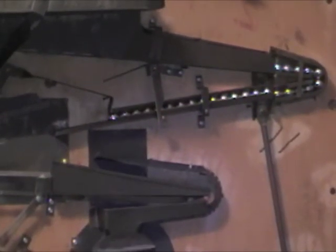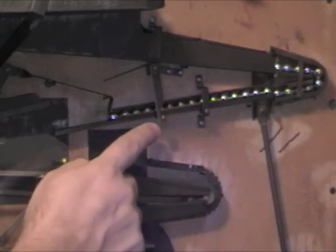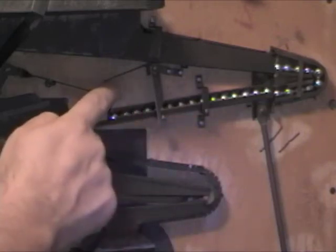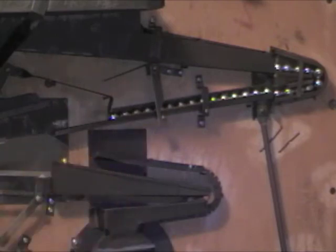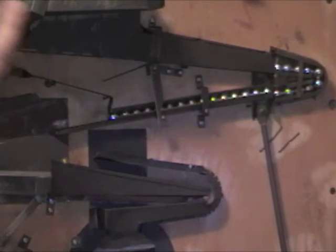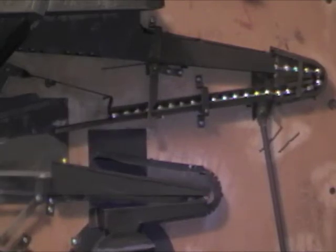Now going up, we see that that pole is attached to this track, and now this pin, there's not enough balls up here, so this lever has dropped down and locked. So the way to solve this is to add more balls to the top, or you could manually push it out of the way, but since these are brass, I don't want to bend them. I'm just going to add some balls to the top. Okay, and it paid out.